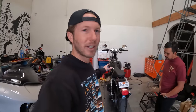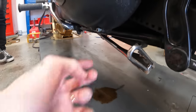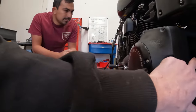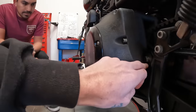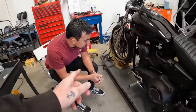The bike has been sitting on this lift a week now. We were at a trade show all weekend and we haven't really had opportunity to ride it or work on it. We come back and there's oil leaking from the primary somewhere. I have a feeling it's coming from the inner primary seal. The bike's level, so the oil level is higher on the inner primary and it's causing it to pour out that side. That's a bummer and we'll have to dig into that another day.